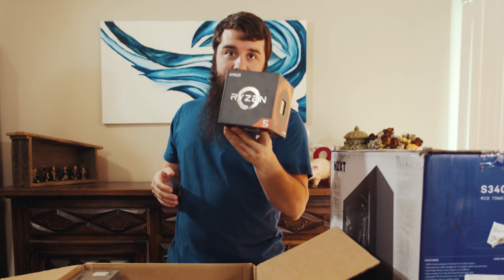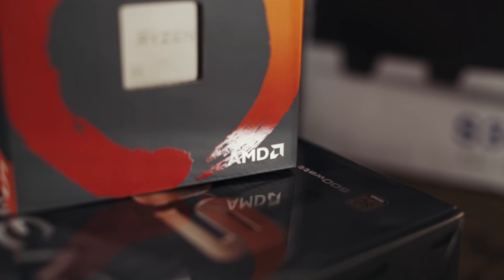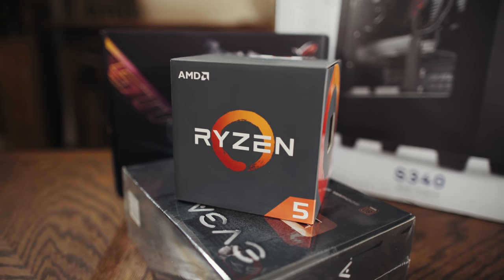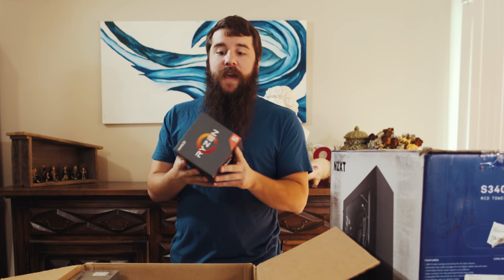So if you are considering building a video editing PC, look at AMD very closely, because I think that in terms of processor power, cores available, and threads, this is an amazing processor. The Ryzen 5 is as cheap as I would go. They also have the Ryzen 3, which is cheaper and lower powered. And while that may sound good because, hey, price to performance here, it is a good chip, but you're only getting 4 threads of performance, not 8 like you're getting with this chip. So spend the $160 and buy one of the Ryzen 5 1400 processors if you're looking for a good budget processor. That said, if you have more money, I would definitely look at the Ryzen 1600, because what that is gonna give you is 6 cores and 12 threads of performance, which is gonna make your video editing significantly faster, especially if you are editing 4K.